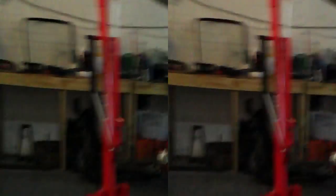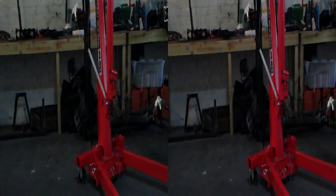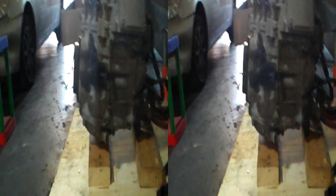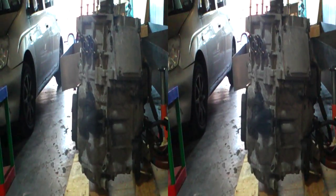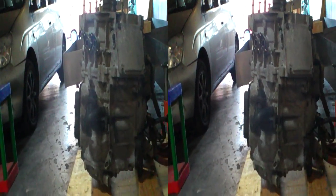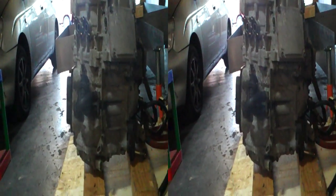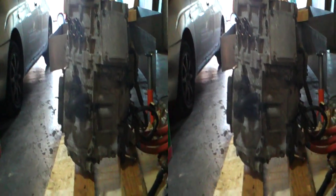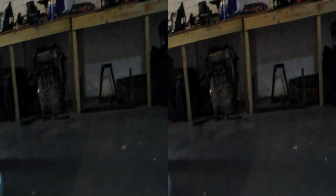So that's 60 to 70 horsepower, which is the equivalent of about 40 to 50 kilowatts in total. Inside there, I believe, there are two motors — one's 30 kilowatts and the other one's about 10 to 12 kilowatts, something like that. Which means you have roughly 42 kilowatts in there, plus a gearbox of course. There's actually a gearbox inside there, so it's got motors and gearbox. And that is actually about half the size of the engine, and roughly equivalent power.